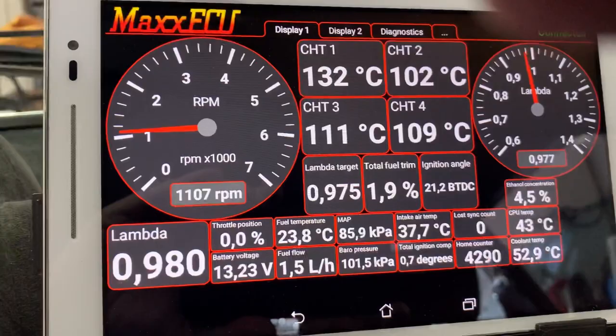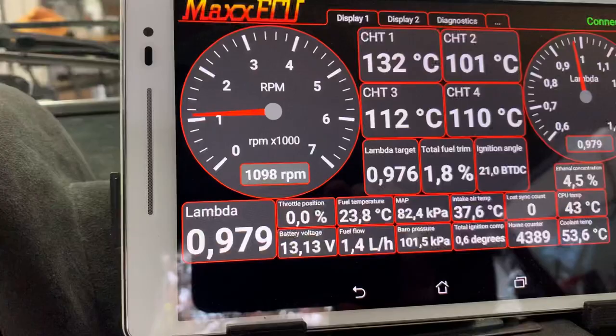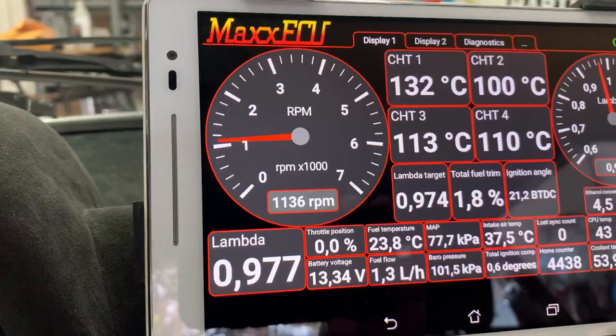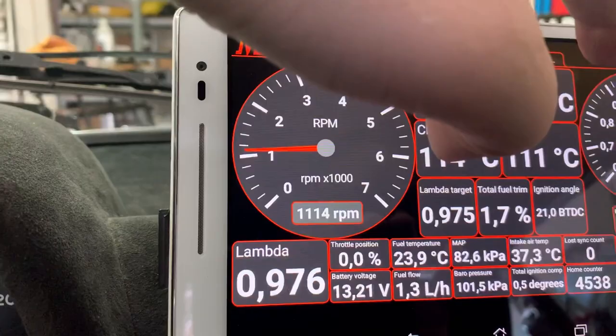When you're driving, you want to make sure these temperatures don't go over 200 degrees Celsius. While driving, lambda should always be less than one — it can idle at one or close to one, but while driving it should be somewhere between 0.85 and 0.8 at full throttle, and around 0.95 at cruising.